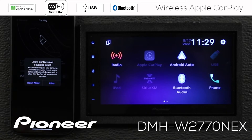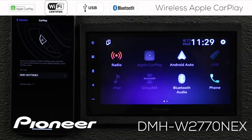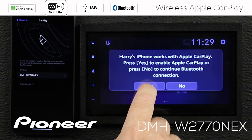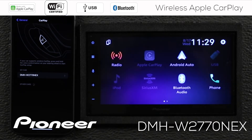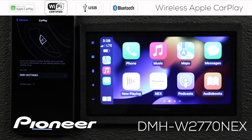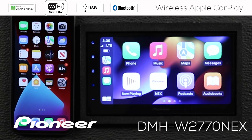Now it's asking if you want to allow it to sync contacts — I'm going to say yes to allow that. And here it says Harry's iPhone works with Apple CarPlay — do you want to enable CarPlay? We'll say yes. We'll wait a moment while the two connect, and you can see the CarPlay button became available. Please note that I kept the CarPlay screen open the entire time on my phone. Now that I have a CarPlay connection I can bail out of here, and that is a one-time setup.